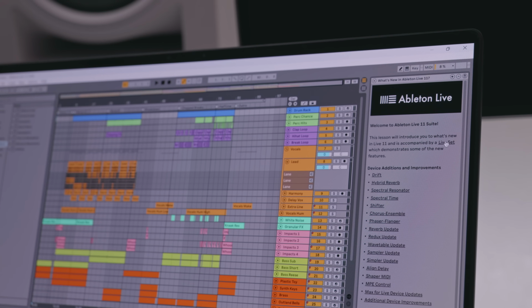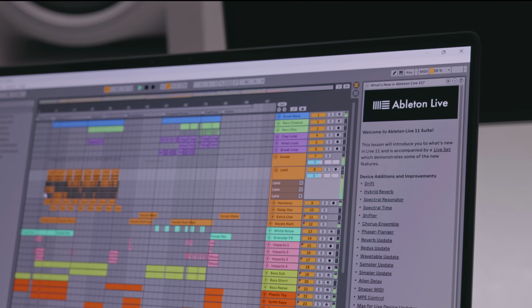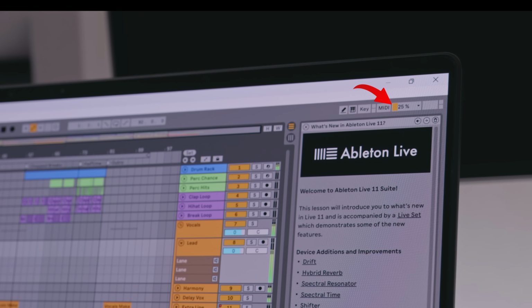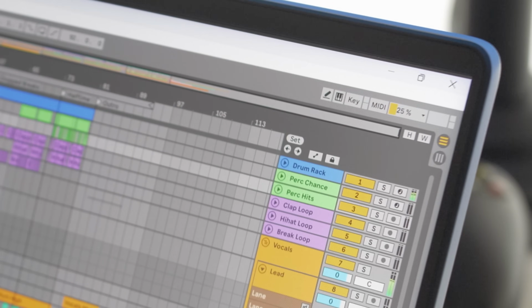And then for my audio people out there, I run an Ableton benchmark. This kind of just shows how well the laptop handles audio, VST plugins, things like that. Hitting about 24% CPU load in the demo session on Ableton, and that's a ton of tracks and a ton of plugins all going at once. So that's a great result. Intel usually seems to come out ahead here over AMD. So, compared to the G14, for example, and lower is better.